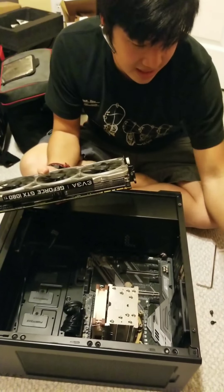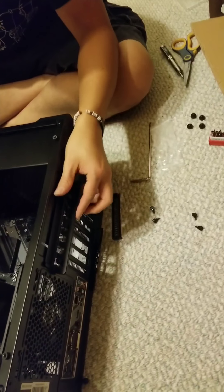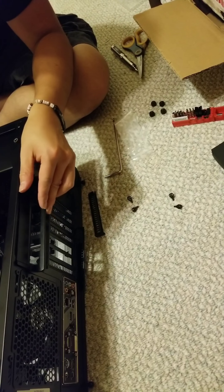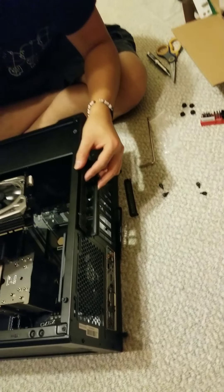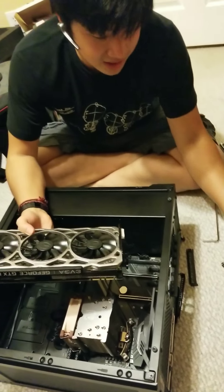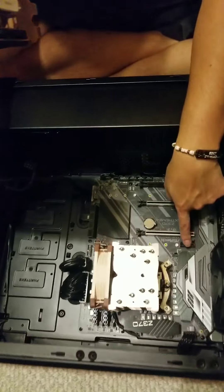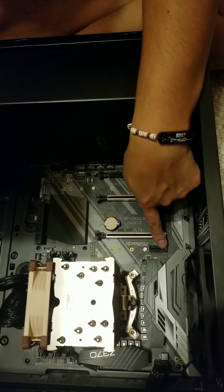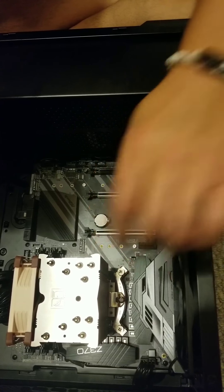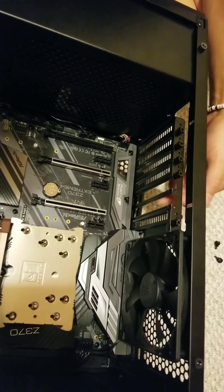On this specific case, they put a plate here to hold these screws in. But even if you take it out to lift it up, you aren't going to be able to get the video card in, so I actually take the whole plate completely off. The slot up here is for a PCIe card and doesn't need to be opened — the video card uses the two slots below it.